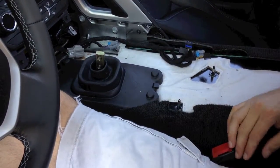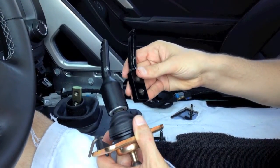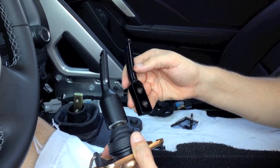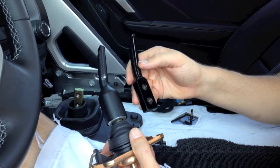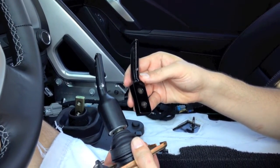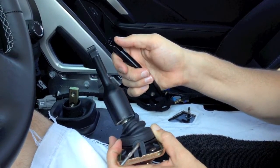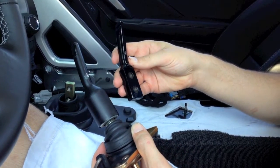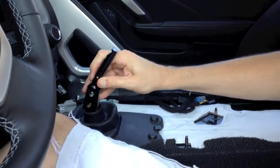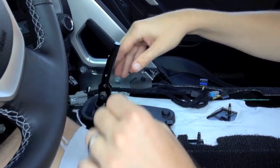With that in place, we're going to install our new handle. The factory C7 shifter and C6 shifter are basically the same units — they're interchangeable. You'll see that we modeled our handle to work after the factory handle. This allows you to use the factory shift knob or a Henson Motorsports specific round ball. Some people have a personal preference of round versus factory. The Henson balls will be available in black or white with the six or seven speed shift pattern on top and the Henson Motorsports logo on the side. These handles are made of heavy weighted steel so you don't have to worry about smooth transitions from gear to gear. They're powder coated and have the retaining screw for the factory shift knob. This install is just like the factory one — there isn't a wrong side; my personal preference is that we offset it to the driver side.